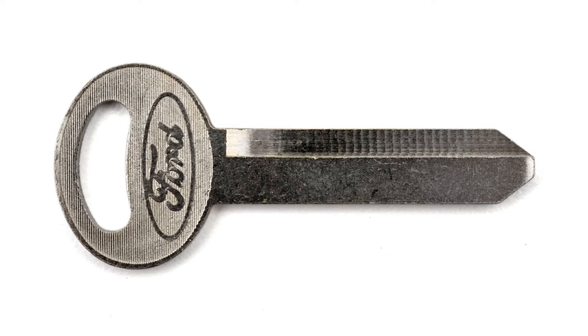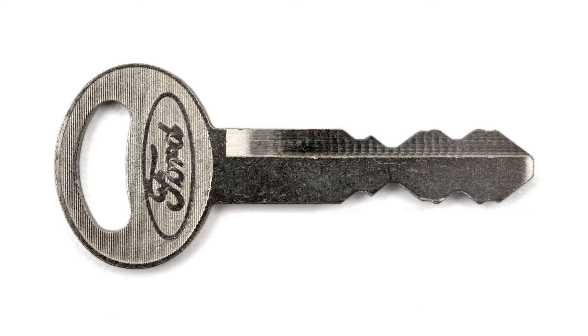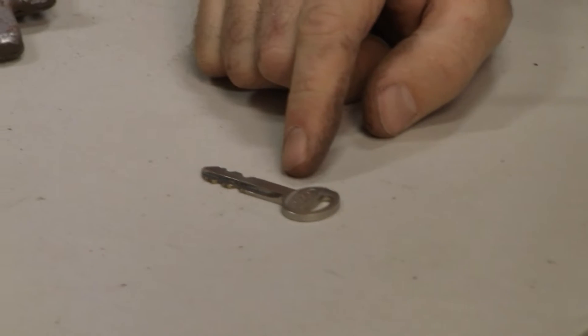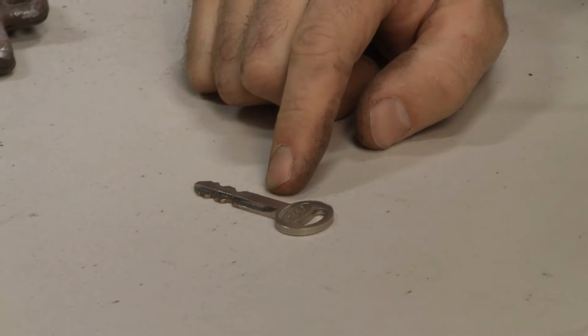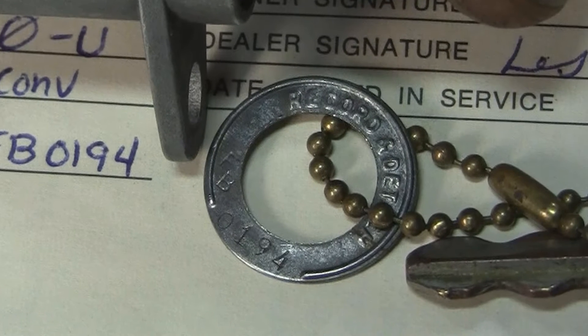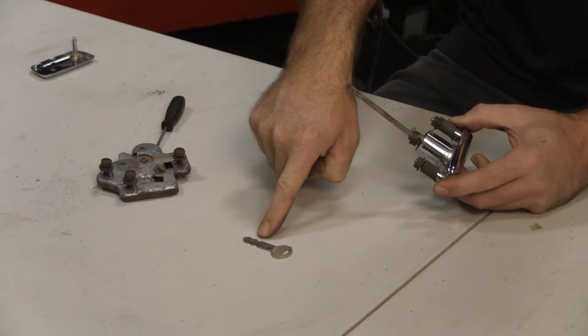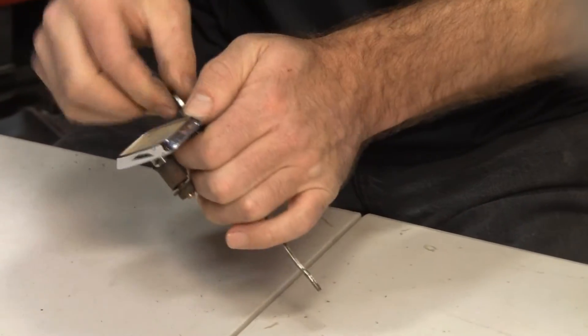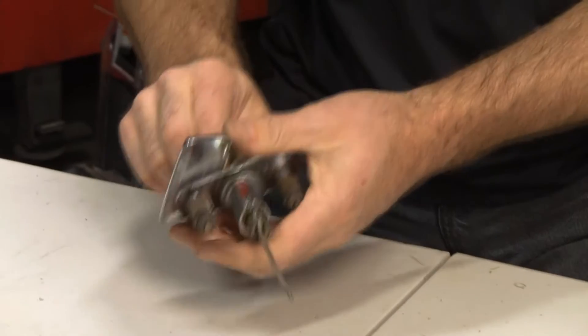Skipping ahead — went to West Coast Classic Cougar, got my key made, and unlike the local locksmith, I got one that says Ford, Family of Fine Cars. It is a correct-looking key. The beauty about a key cut from the factory code — which, by the way, is also in your owner's manual or on the fob if you still have it — is that you're not doing a copy of a copy all worn out. You get crisp, sharp, correct edges. It fit perfectly the first time. No wiggling, no jiggling — we got the right key.